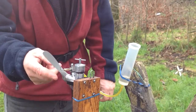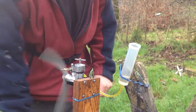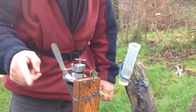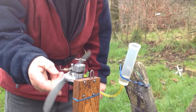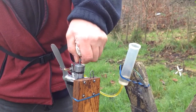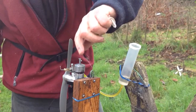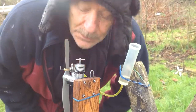Okay, so we've got plenty of fuel — let's have a go. A few smart flicks. Maybe a tiny bit more in the exhaust — a drop is all you're looking for. Give it a bash a couple of times like that, make sure it's not flooded. That should fire — we probably need a little bit more compression, an eighth of a turn maybe. That's flooded — back it off, blow through the exhaust, clear it out.